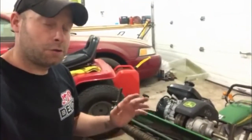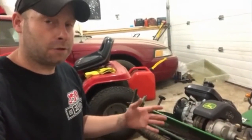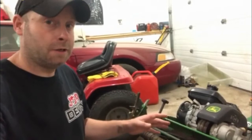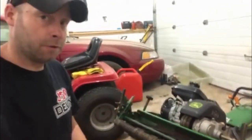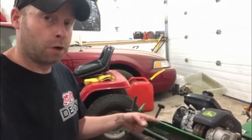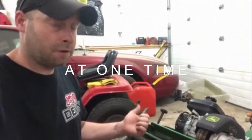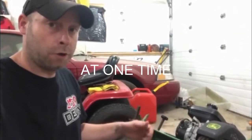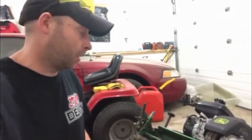So again, guys, don't be intimidated by backlapping your reel mower. If it's your first time doing it, just don't be scared of it. It's really easy, and I'm guessing that's why you clicked on this video. So I hope it did help you out. But yeah, it's simple. I use the 220 grit because that's what I had available, which means I do have to grind a little bit more because it doesn't tear off as much steel at the same time. But if you start with an 80, that's fine. You can just use an 80, or you can go 80, 120, 180, then 220, and work your way up if you want to get it tweaked, like dialed right in.